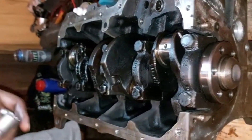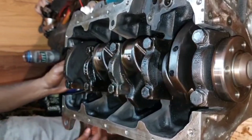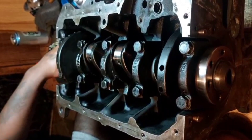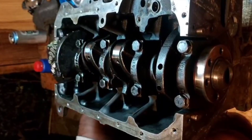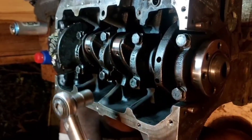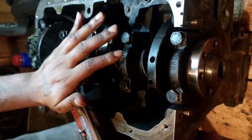Got my 19mm socket and the ratchet. You saw that I was able to manually turn the crank, but all the bolts are just placed — not yet tightened, just brushed down. Now I have my torque wrench here set to 65Nm. I'm going to start from the inside going out. 65Nm — yes! So I'm going to chalk it down.